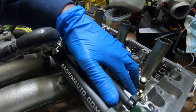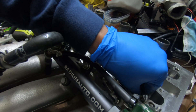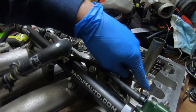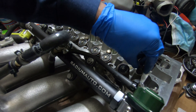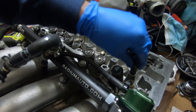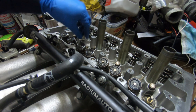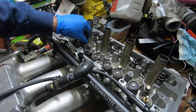Looking down in here I can see debris from everything that happened during the damage — it got in and made it even worse. These little things in cylinder heads are called LMAs — Lost Motion Assemblies. They basically just keep the center roller afloat on the rocker assembly.